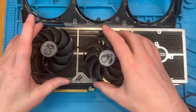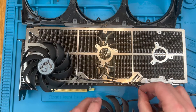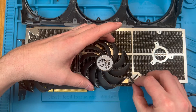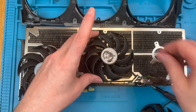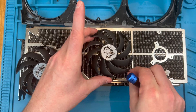The hardest part of the job is getting the fans lined up on the screw holes as the cable alignment can pull them off centre. The best way to make this as simple as possible is to place the fans directly on the screw holes where you can feel that they are keyed, meaning that there are indents in the fans that line up with the holes and stop them sliding around. Once each fan is in the right spot, hold it and route the cable into its aluminium clasps.